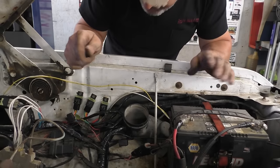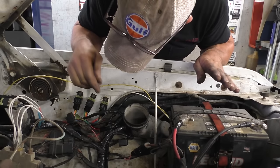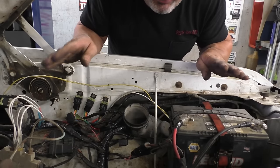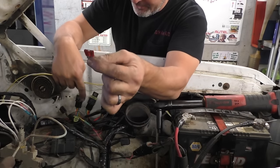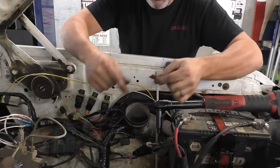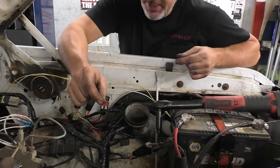I just gave her a couple rev up tune-ups. Let me get Mrs. O out here and we'll see if our fuel pump just died. That would be great if it did. So the reason it quit, we never checked to see what the current draw was on our fuel pump ASD circuit. I probably should have thought a little better.